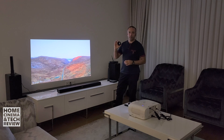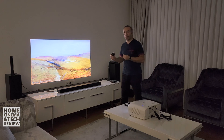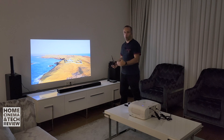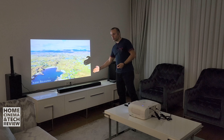When you expand the same picture to double the size, you lose the light. If you have an LED, laser, or any small portable projector, don't use these converters — increasing the size means nothing if you don't have the light source to back it up. That's why ultra short throw and short throw projectors are actually expensive. When you go wide, it doesn't matter if you're close or at a distance — you need more light.